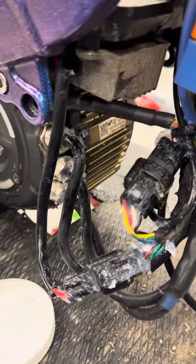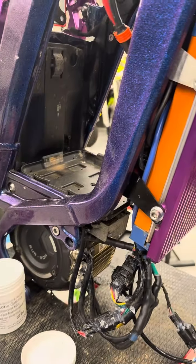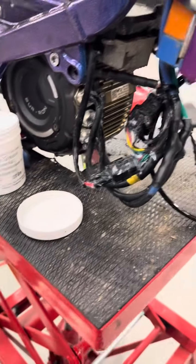We also remove the rubber boot, which quite frankly is junk. With the dielectric grease, we've waded our bikes literally halfway up, about here — we're not that bothered about it. It's all down to this greasing — horrible stuff to apply, but it does a great job.